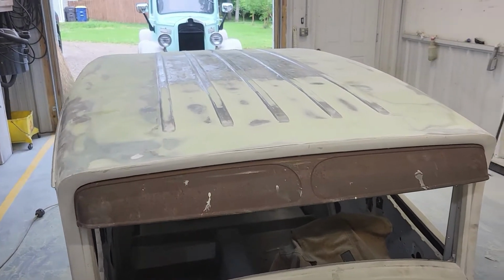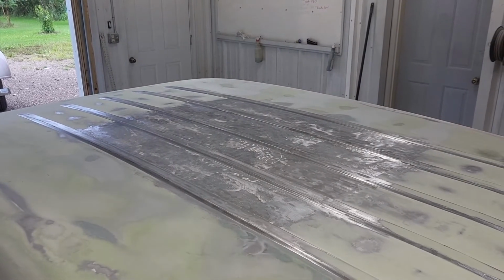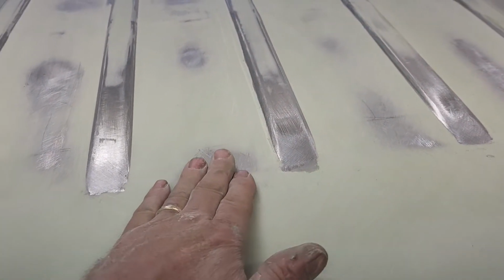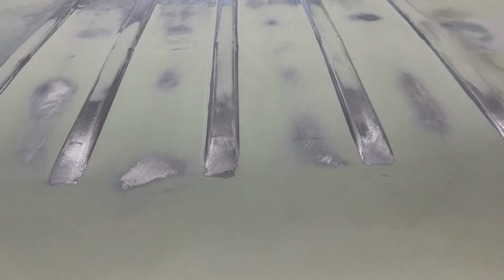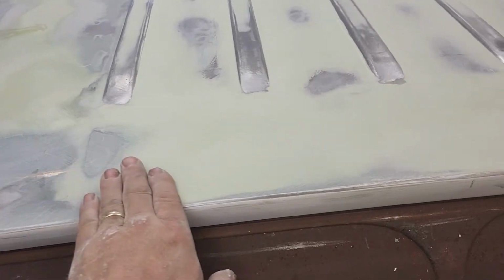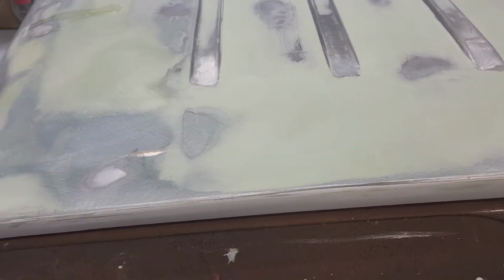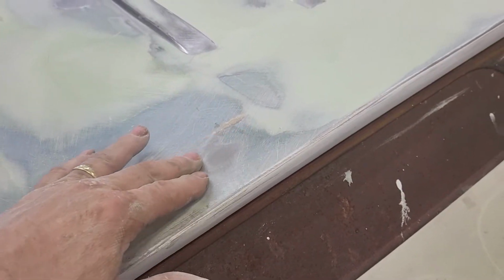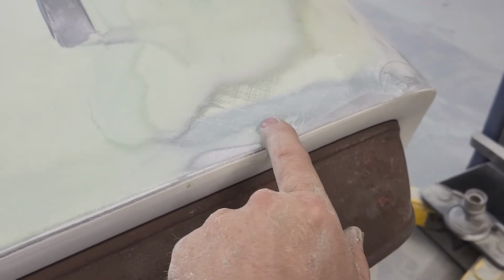All right, back at you. Front is 80 grit. I just have that left to do now, which goes pretty quick. You're just blocking it out to cover the sand scratches for the most part. I got this one little spot, and it looks like a bubble. So I might have to just do a dink, because that's where it's at. Anyway, the rest of it, even that, just feels really good. I'm going to have to get a little bit of, come on, my mind is just mashed potatoes right now. Glaze. This is going to have to be just a little bit of glaze here because I'm bridging this all into here. So we'll glaze that. This side came out really good, except for right there. It's a little glaze.